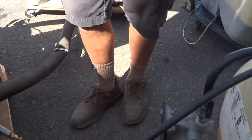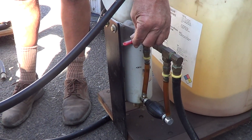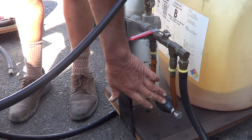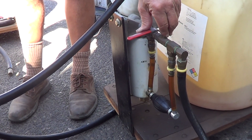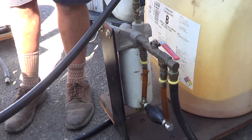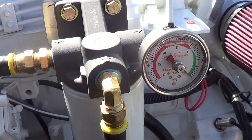Look down here. The normal flow is like this — it'll measure average restriction. If I close this, it's going to make the fuel suck through the squeeze valve, which is going to add quite a bit of restriction. You're going to see it on the gauge. So I'm going to start it just like this and we'll see what normal restriction is. This is pretty small fuel fittings on this thing, so we are going to see some restriction.